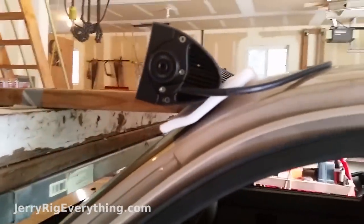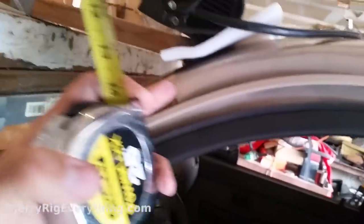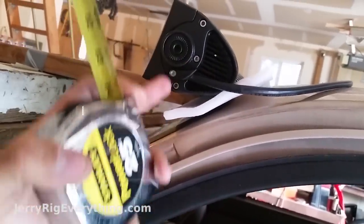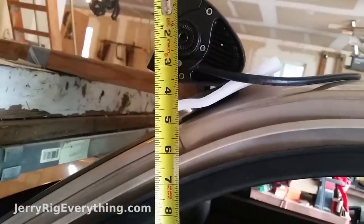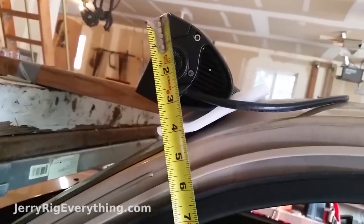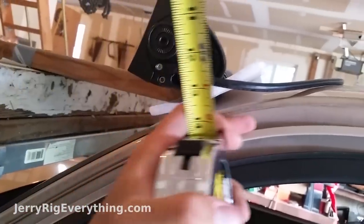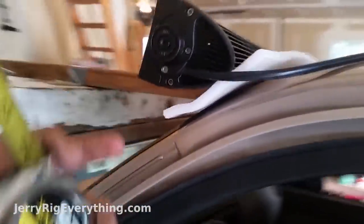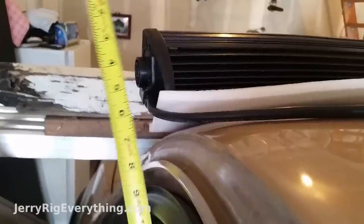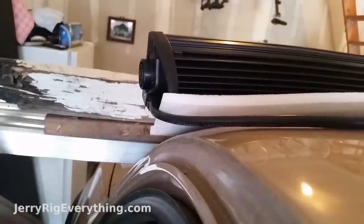This is how we're going to design the brackets. From the top corner we're going to screw the brackets in right along here under the frame of the truck, and it just has to extend enough so that we can screw into the side of the light. The metal has to be at least 6 inches long, and I'm going to curve it to go with the lip of the metal here, then bend it out just a little bit so it will mount with the edge of the light bar itself.